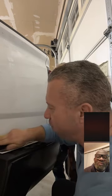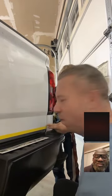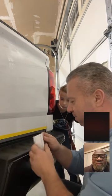What happens when you remove an old pinstripe off of old paint? What happens underneath there? It swells. Correct. And so you think, oh, it's no problem, I can just polish it out. No, you cannot. It's taller, and the clear coat's bigger in that spot.